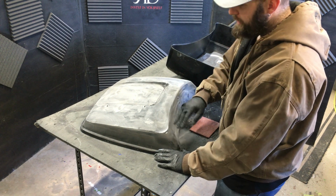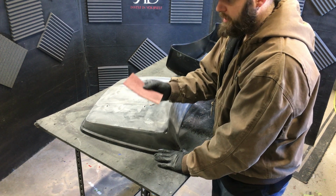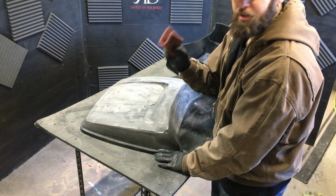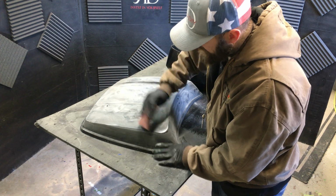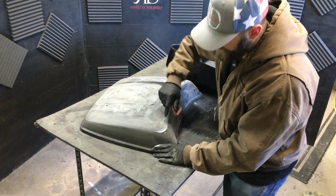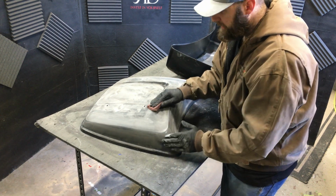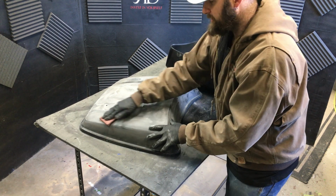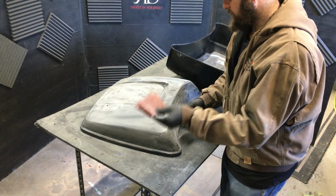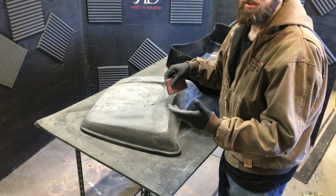So what I'm going to try to do is stay away from those areas with the DA and then just go back over it with this red Scotch-Brite. I'll put a link down in the description to where you can get your own, and you just hit all them hard to reach areas, those curves, anywhere you couldn't reach with the DA, where it was a little more dangerous, where you might burn through it. More flat surfaces are easy with the dual action sander. That's to speed up the process. So we're just going to hit this whole thing with the red Scotch-Brite, just make sure we have good toothing for the paint to stick to.